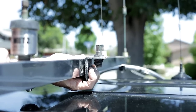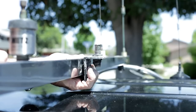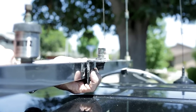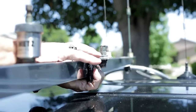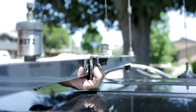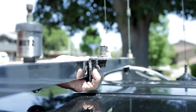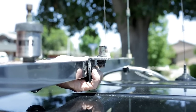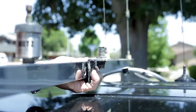This is your typical light bar, and it's a favorite among hams to mount antennas on the light bar, so when you sell the vehicle you can take your antennas with you. The problem is, with the HF antenna mounted right here, there is so much capacity between the feed point and the metal of the vehicle. Even though the light bar is well grounded, you won't be able to overcome it with any type of antenna bridge. This is not a good spot for HF — it's fine for VHF, but for high frequency, forget about mounting it on a light bar where there's only one or two inches between the bar and the metal body.